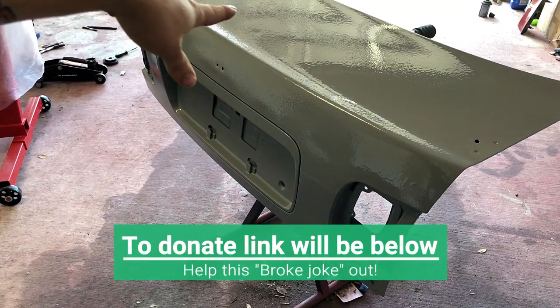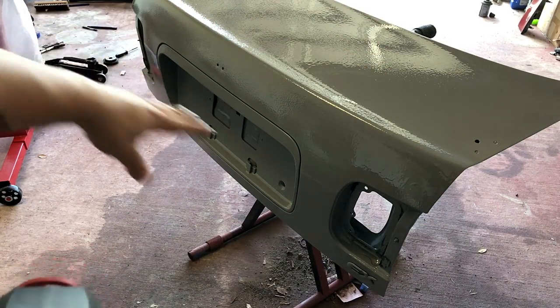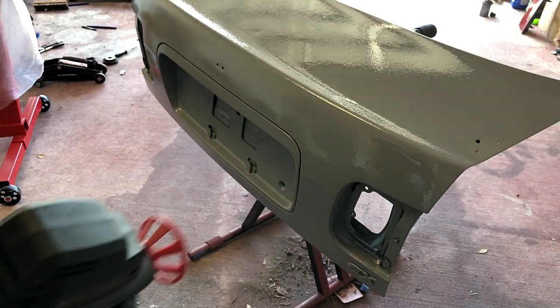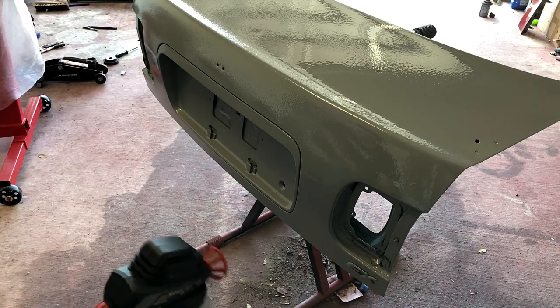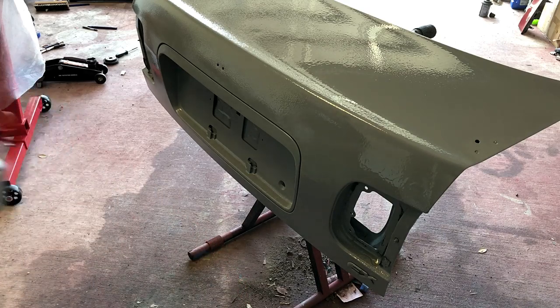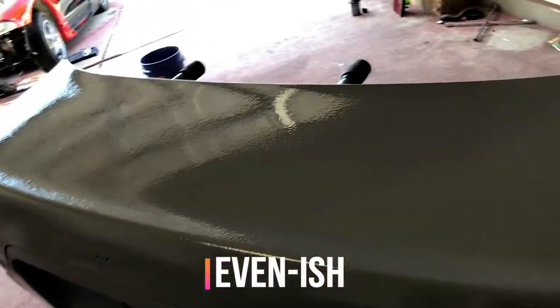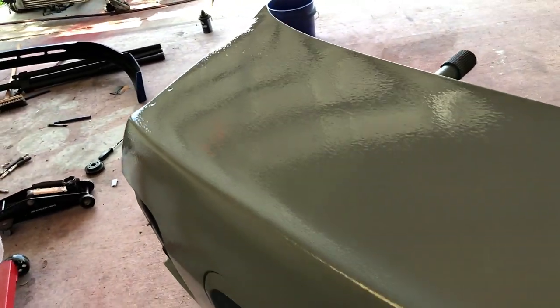As you can see, there's a lot of orange peel — but don't worry, that levels out a lot. I'm going to go ahead and hit what's left down here. We're just going to do it anyways with what's left in here. There wasn't really anything left in there. So that's basically what it'll look like right after you spray. Don't worry, this will lay even. Once it dries, it will dry just a little bit smoother than this. Then the wet sanding and buffing will take place.